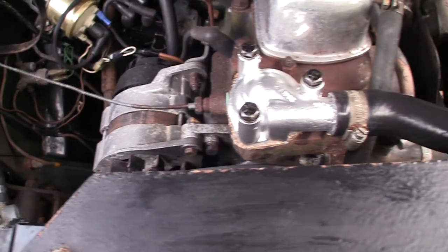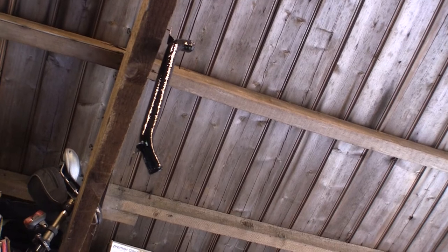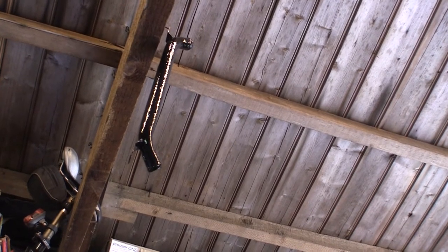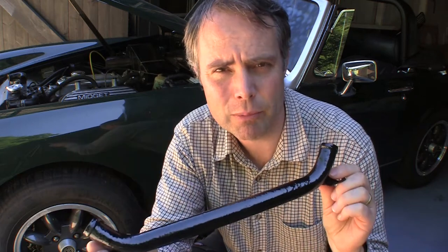That's been pretty successful — the water came out pretty dirty from the chemical flush, which has now been washed out. We're just waiting to fit the new thermostat and new gasket. We've tidied up the thermostat housing and treated the bolts so it all looks a little bit smarter while we've got things off. The cross tube — we're waiting for that to dry before putting it all back together. The water cross pipe is now fully painted and repaired, ready to go back on. Then once it's all filled up, run it up, check for proper operation and make sure we've cleared any airlocks.